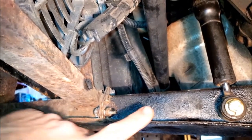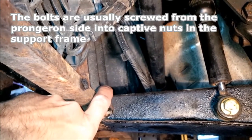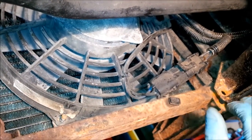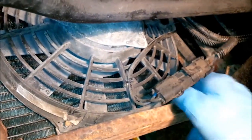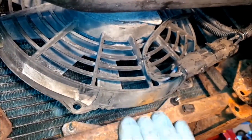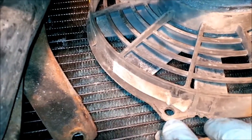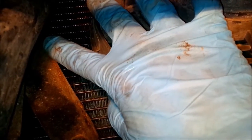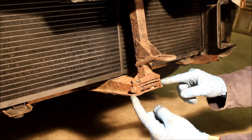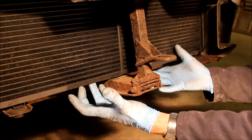Then release the three bolts which secure the pronger on the engine under frame to the radiator support frame. There's one each side at the bottom just here and then there's another one on top of the pronger. When you have those three bolts undone and you've got yourself a bit of wriggle room, slip the radiator fans off their studs — pull the bottom of the radiator fan backwards and that will allow the support frame and the radiator to drop down. Bear in mind that the spigot for the top radiator hose is still between the prongs of the Y piece, so when you take the radiator out you'll have to pull it forward slightly so that the radiator hose spigot can clear the Y piece. Then undo the one remaining bolt that connects the radiator support frame to the bracket for the tow bar and the whole radiator and subframe assembly should drop down.